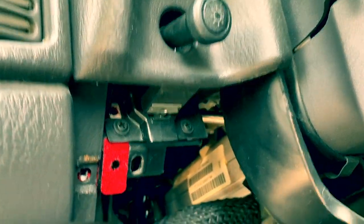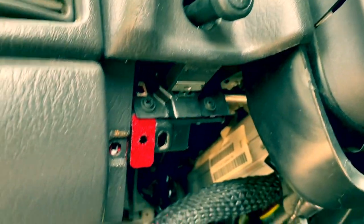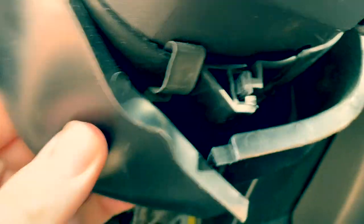This particular Cherokee has over 252,000 miles on it — actually just turned over 253,000. It's been a great vehicle. If I would have known better I probably should have bought a new headlamp switch — maybe I'll clean this up. Every once in a while, especially in the morning, the lights kind of flicker, so that switch is probably getting weak or just needs to be cleaned up. It looks like this can possibly slide down a little — and it separates. We've got another screw here in the back, so let's go ahead and tackle that. This might be slightly different depending on the year — this is a 2000, so your application might be slightly different.